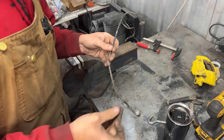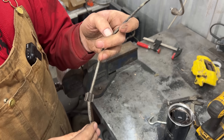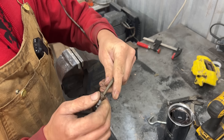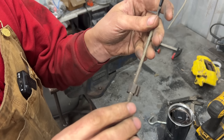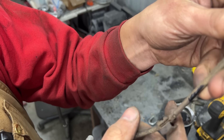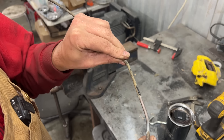Let's start with the brake lines. I took out the first one — these are the old steel brake lines, all prone to rust close to the fittings. This one is actually not too bad, but I went and cleaned it on the wire wheel just to see. It doesn't look way too bad, but we're replacing them all anyway.